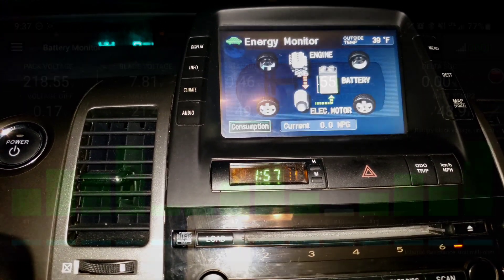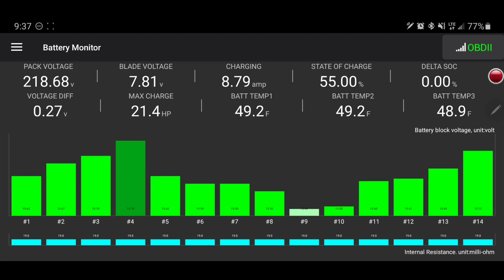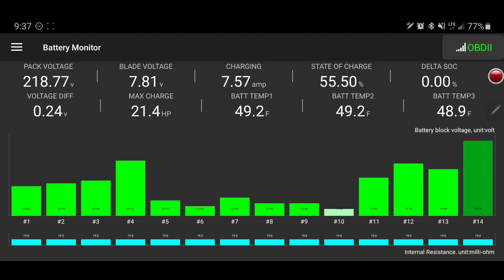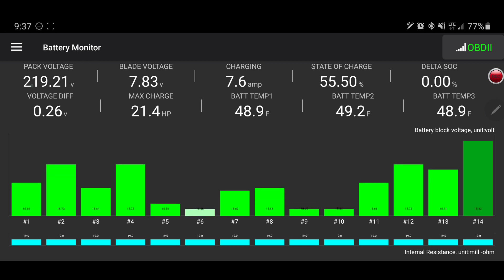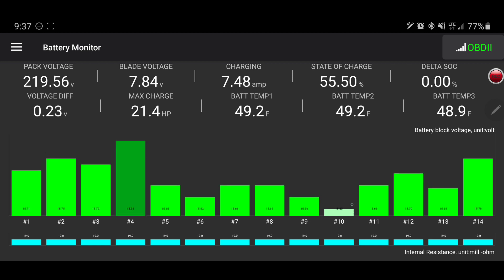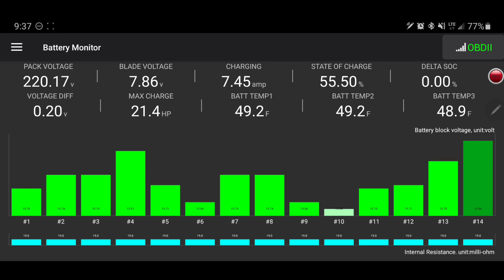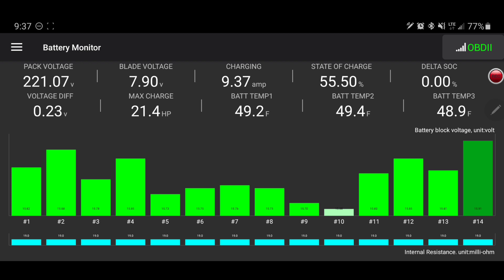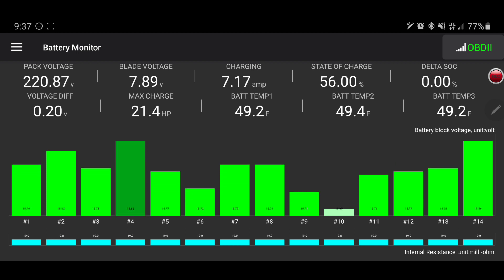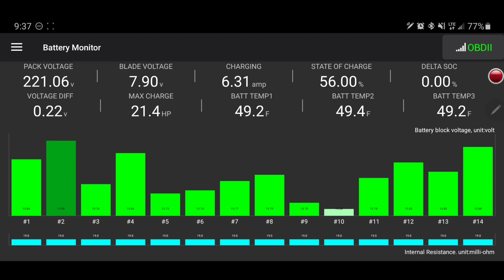So we are in the Dr. Prius app, and I just wanted to check out a few things. The battery is pretty cold — it's 49, 50 degrees here — and it's at 55% state of charge. What I wanted to check was the voltage difference between the highest module and the lowest module. The lowest is looking like it's number 10, and the highest is between either number 4 or 14. The biggest question I get when accessing the Dr. Prius app is, 'That bar is really tall and this one's really short — that looks really bad.' That's just the design of the app. If we're looking at the voltage difference right here, which is currently 0.18, that is definitely within acceptable limits.